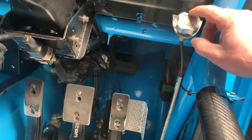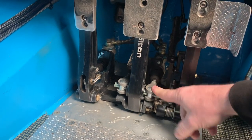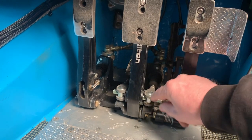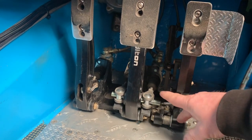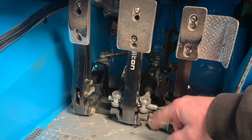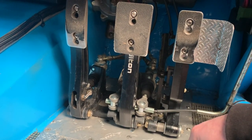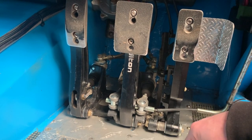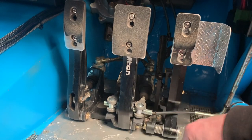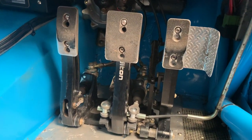You have your normal brake bias to move from left to right to get front to back. You have a front brake master cylinder and a rear brake master cylinder, and the balance bar just moves back and forth as you adjust it, so you can adjust the pressure on the front or the back. I like it just sort of level in between. I get everything hot on the car, get down the road, get my grip levels sorted, then start braking hard to try and lock up all four wheels at once. It takes a bit of messing around and you need to bed the brakes in first, so it's time-consuming, but it's well worth it when it's done.